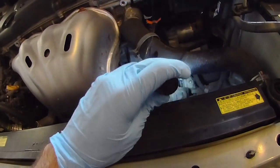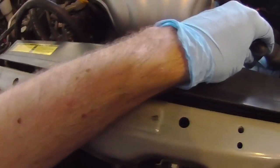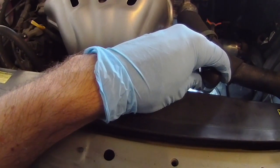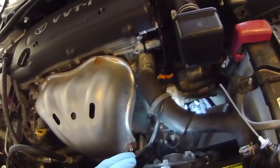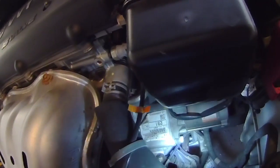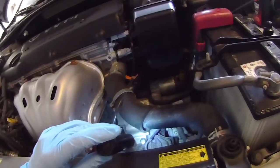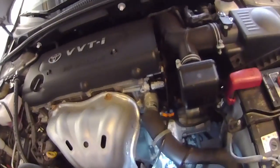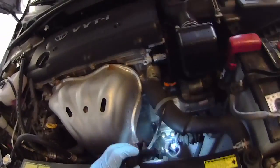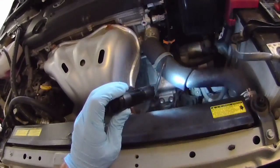I'm going to have my lovely assistant depress the clutch, which will allow me to get both sides of the joint. There is actually a hole that lubrication can be added to on both sides. I'll be in a pretty contorted position to get the lubrication in there, but you can position yourself to look into the opening and even see a little bit of the pressure plate from the hole. You'll be able to tell if you've got lubrication on the joint — more importantly, when you're pressing the clutch, if you've got lubricant where it needs to be, it won't make noise.